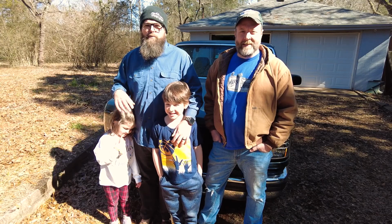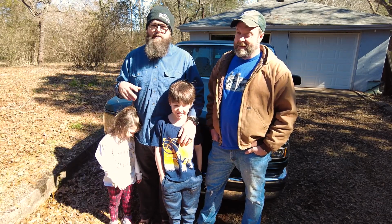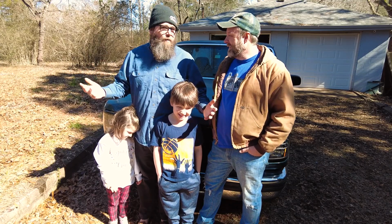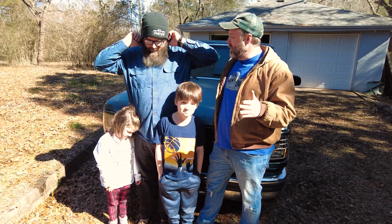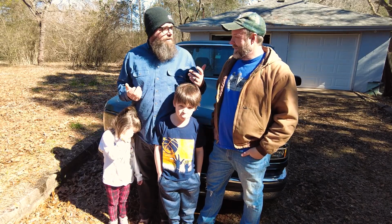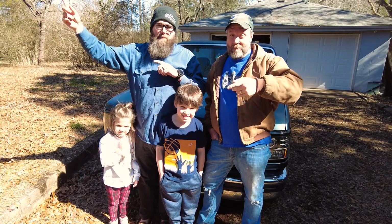All right, guys, thank you so much. We appreciate all your support. Thank you, Gumby Sanders, for giving us that insight. Turns out we had a bad thermostat. We did. A second one. And we had a lot of air in the engine. If you noticed in the video just before this, a lot came out of that bleeder.